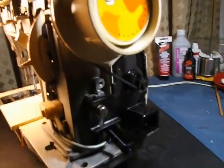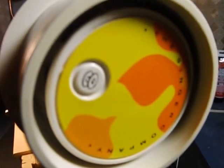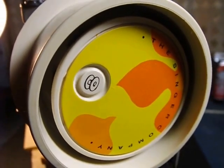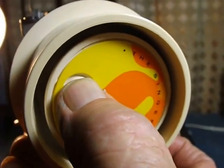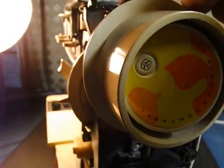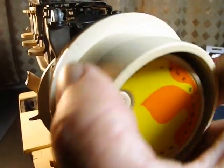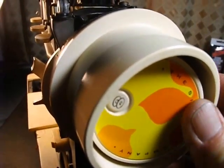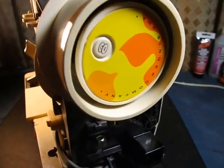Let's swing this around and look at the back end. It's a cute little machine with some nice features. This is the handwheel. You see that little white round button with the bobbin symbol on it? When you want to wind the bobbin — which is built into the top cover — you just push that in. You get it locked out, then when you run the motor the wheel will turn and the bobbin wheel will contact up here and wind the bobbin, but it won't move the needle bar or the bobbin hook. When you're done and want to go back to sew, you just pop that back in. Push it in to wind the bobbin, push it back to sew.